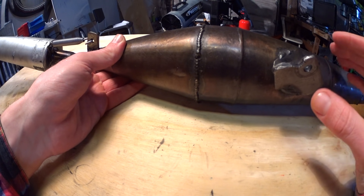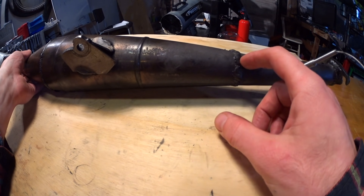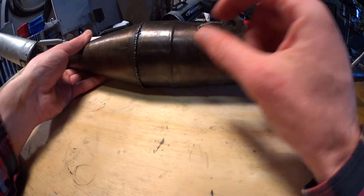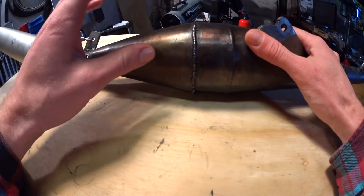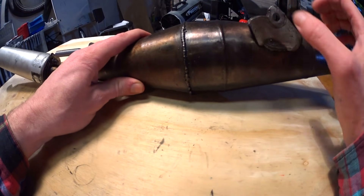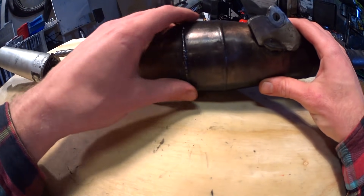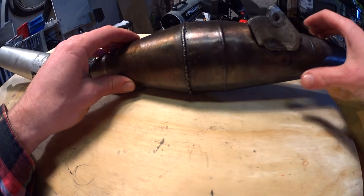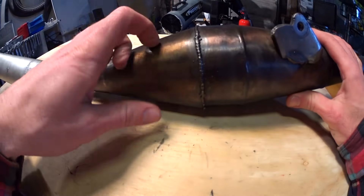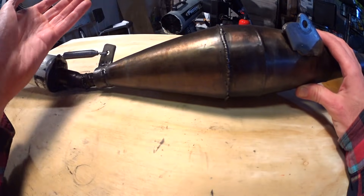Check for and eliminate any restrictions in your performance exhaust system. Some of them are really bad from factory, with the header protruding into the chamber, lumpy welds, maybe some overlap between the sections, and even restrictions inside the chamber. Take a close look, see if you can find any restrictions or uneven stuff in there and remove it. The pipe should be clean on the inside with distinct changes between the sections. A good way to check this is to look for spot welds — if there are spot welds, there's probably a restriction plate, some sound dampening, or something in there.